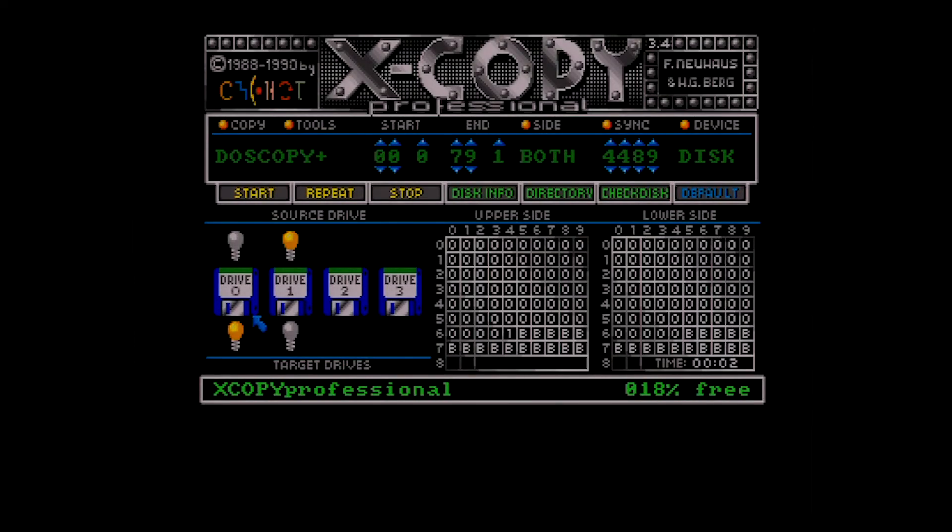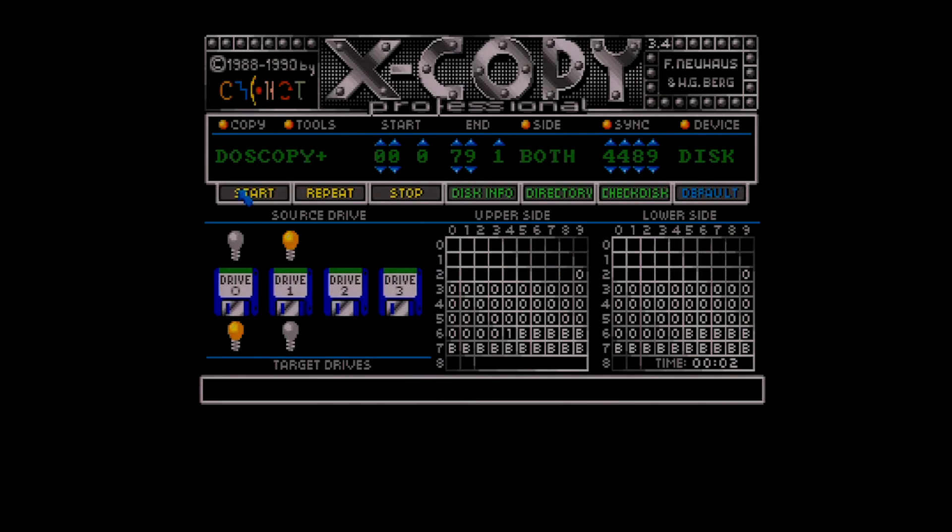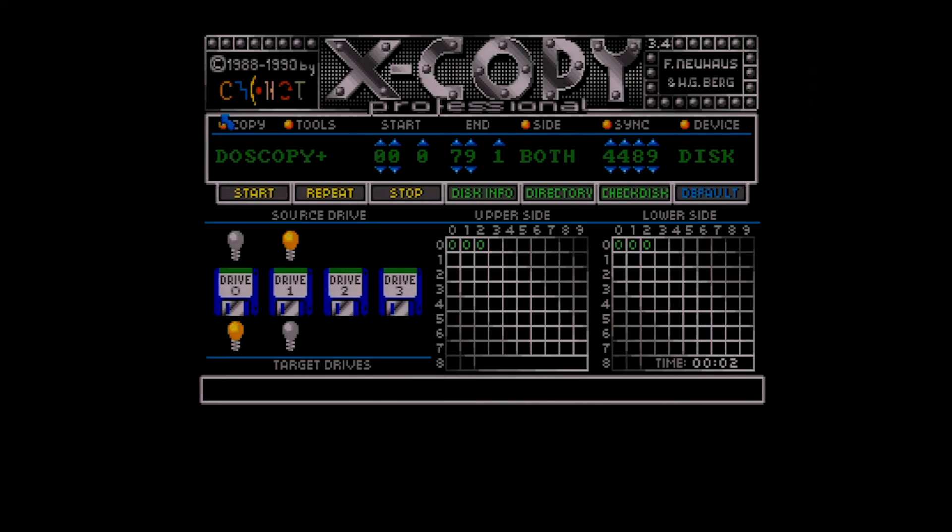As an example of the power of keeping both the internal and external drives working, you can use copy programs to copy back and forth from a real floppy disk to a disk image and vice versa. In this particular case I'm setting up XCopy, and I can select the source drive and the destination drive — there is 0 and 1 — and then perform a full copy. Here I'm copying a disk image of Defender of the Crown onto a floppy disk. That was pretty straightforward, and I hope it will serve you as a guide if you decide to set up your Amiga 500 in the same way. If you liked the video, please give it a thumbs up, subscribe to the channel, and until next video, see you then.